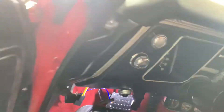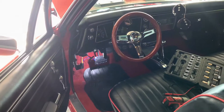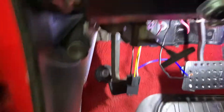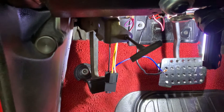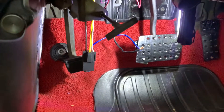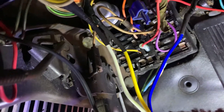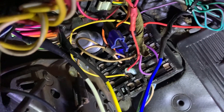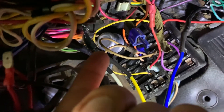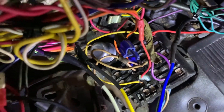Oh yeah buddy — that's a good sign! Let's try one more time. That's 12 volts to the starter — sounds like my people! Success. We know everything works; now it's a matter of connecting them correctly. I'd like to put butt splice crimp connectors on these but I don't have any, so I may solder it — which is the correct way to do it, but of course it takes longer and I'm in a tight spot. For you it was only a few seconds; for me it was about an hour and a half, maybe two hours. I went ahead and soldered them — this solder joint here turned out pretty good. These two were a little bigger so the shrink wrap I put on didn't go all the way over, so I just taped over it. Not the best idea but it gets the job done — that finalizes this piece.